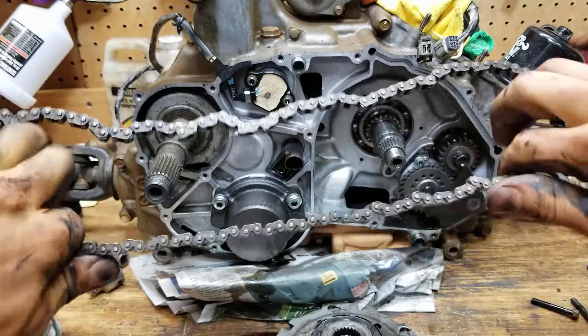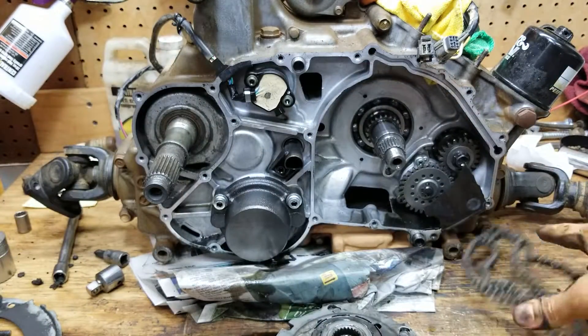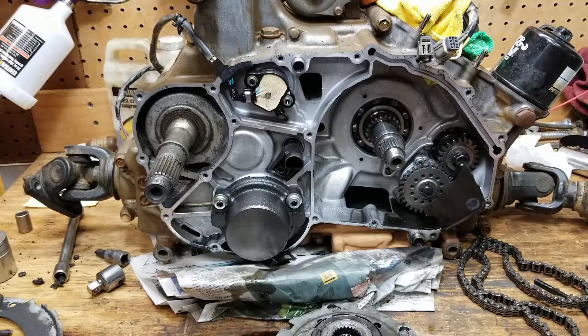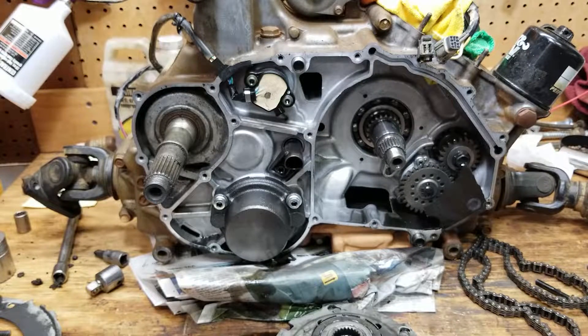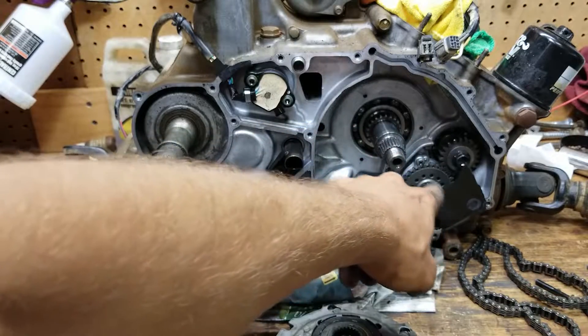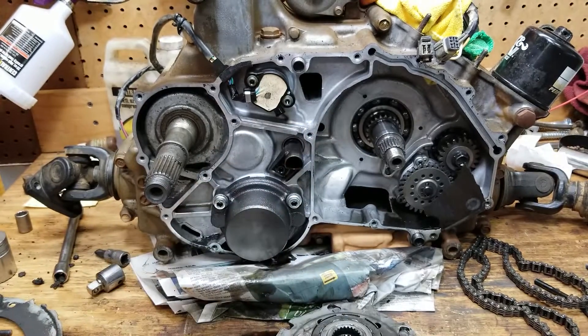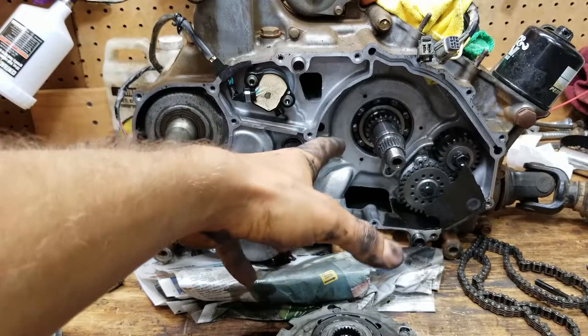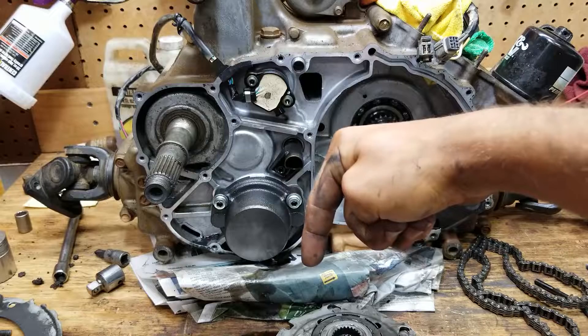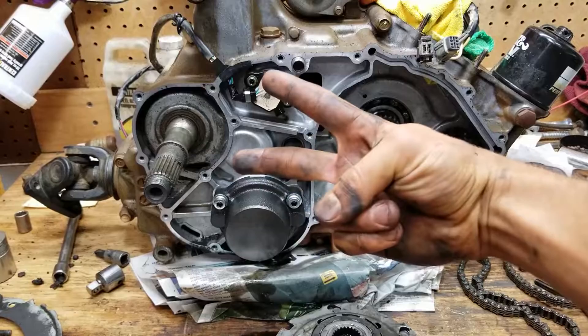Here's the old timing chain — cam chain — this thing is destroyed, so I'll need to get a new one. Already knew that. Setting that aside. Everything else looks pretty good besides that. The bearing seems pretty good. I'll have to flush out the gear case and get all the gunk out of there. I'm going to end the video here because I need to go order parts: new shoes for the clutch, maybe a new drum since it's grooved out, a new timing chain and gasket. When I get those parts, we'll do a reassembly video. I'll put links in the description to anything I can find online. Thanks for watching — if you enjoyed this video drop me a thumbs up and don't forget to like, comment, and subscribe for the next videos of me rebuilding the rest of this. Peace!